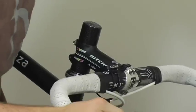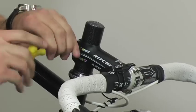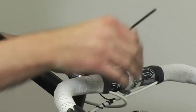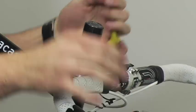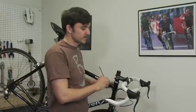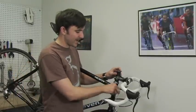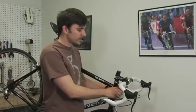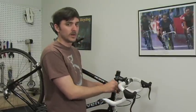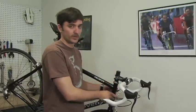Readjust your headset and align your bars. Then go back and tighten your stem clamp bolts to the proper torque, equally and evenly. It's the same method for raising your stem. And if you have excess cable on either your shifters or your brakes — or not enough cable if you've raised your stem — you'll need to recut the housing and cables to fit.